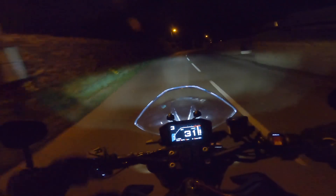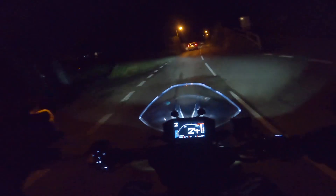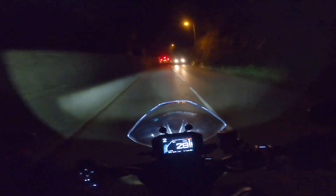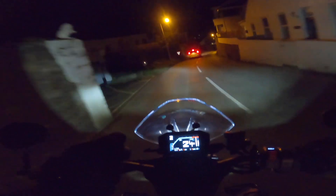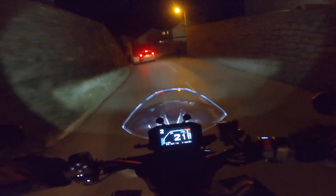This bike is predominantly ridden on the road, as you can see here — quite bumpy — so I've actually softened the suspension off. If you're a light rider, heavy rider, or carrying luggage, or you've adjusted the suspension, then just take time to get your Torx T20, which is what you need to adjust the position of the headlight dipped beam. Very straightforward.